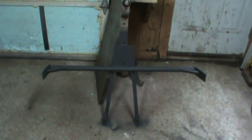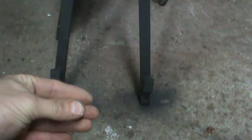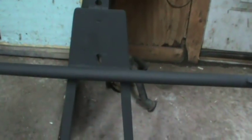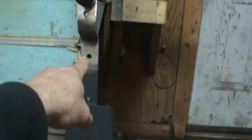There's not much to attach to underneath the bus because the motor's in the rear. That V piece right there is actually from a Beetle. What they do is, back by the frame horns where the tranny mount is, they sandwich a plate and get some support off of that. That part from a Beetle is the same on a split window bus, so I utilized that. Then I had to kind of come around and catch the two frame rails where the bumper bolts to, and continuing on where that hole is, it's going to bolt to the bumper too, giving me five attachment points.